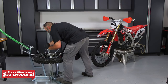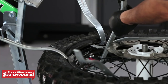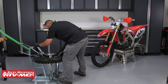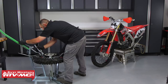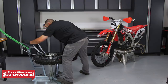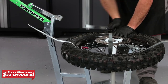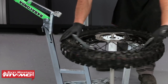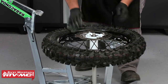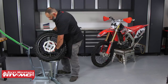We're getting close at the end, just taking little bites. Getting close to the bead lock now — push the bead lock in, spin this around a little bit, use the Rabaconda to push that in and release it all, then pull out your tire irons. The last step is just to tighten up that rim lock — get that nice and tight — and you're ready to go racing. No more flats.